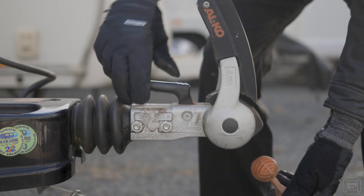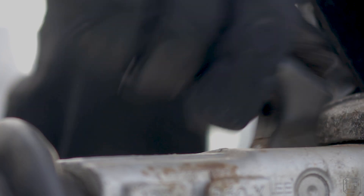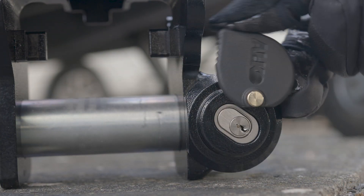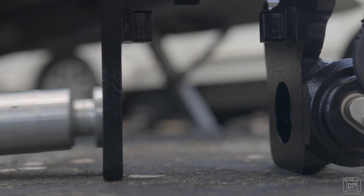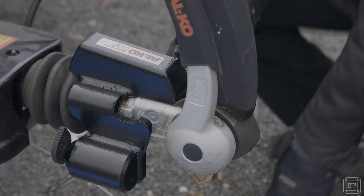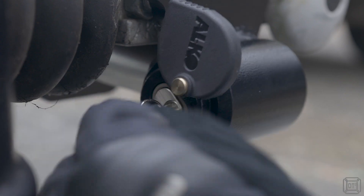With the basic details of the lock covered, let's head over to the caravan to see how it works in practice. Unless the caravan is hitched to the tow car, you should fit the Alco safety ball into the tow ball by lifting the hitch lever, inserting the ball and then lowering the lever again. To fit the lock, rotate the weather shield, insert the key and turn it just under a quarter turn clockwise until the lock body pops out. The retaining bar can now be slid out — there's a slight flange at the end of the bar to give your fingers some extra purchase. Next, lower the lock directly onto the hitch with the two metal lugs aligned with the slots on the hitch body, then slide the retaining bar back in, press the lock in, and turn the key back counterclockwise.